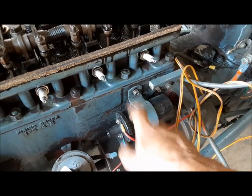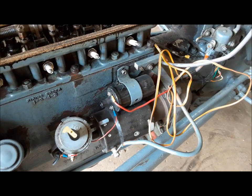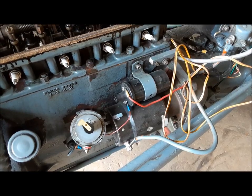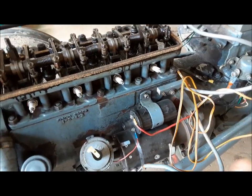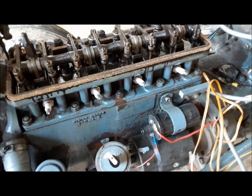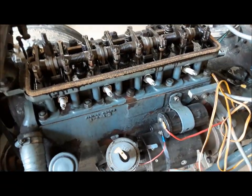This could be a suspect too, but to me it just does not seem like an ignition problem. I've had plenty of ignition problems in my day and this does not seem like a weak spark ignition problem. It could be a good spark in some cylinders and no spark in other cylinders — that'll exhibit these type of symptoms too.